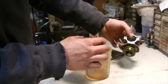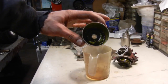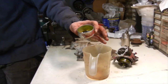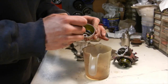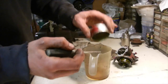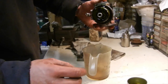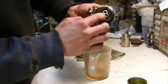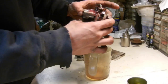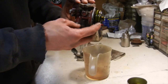There you have it — nice and green. You can see the bowl too: that's all full of shellac and whatnot, pretty gooey stuff. If I can dry it out with some brake cleaner it's nothing the bead blaster can't take off, which shouldn't be too big of a problem. Depending on if the float is any good, I have another float I can put in it. So I'll take this apart, get it cleaned up — if I have to I'll run it through the blaster, if not get it all back together with some new gaskets.